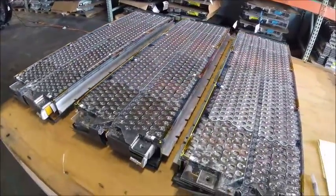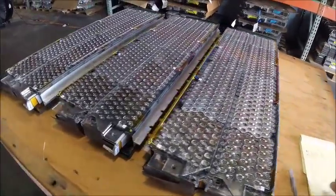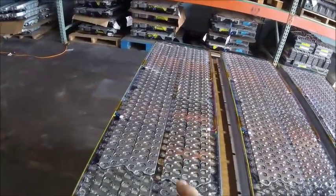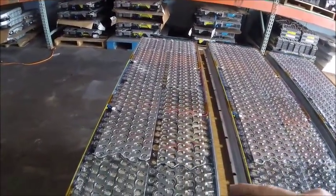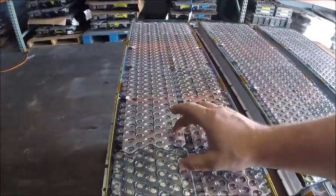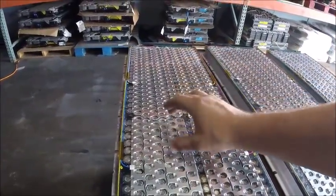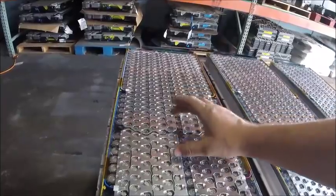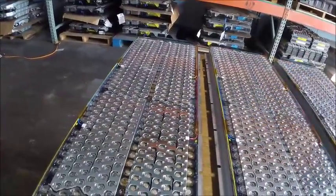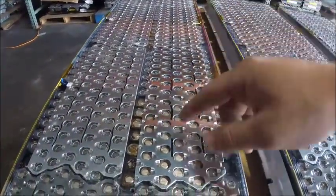This second one is 31.2, and this last one is 42.3 volts. So this one has 2 blocks that are more than 6 volts. I believe it's these two, because I can't read each cell individually, I have to flip it over. These 2 totaled 6 volts, so it means each block, if even, is 3 volts. And then the rest of these are essentially zeroed out.